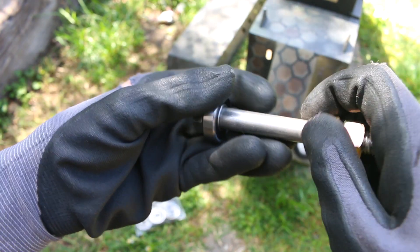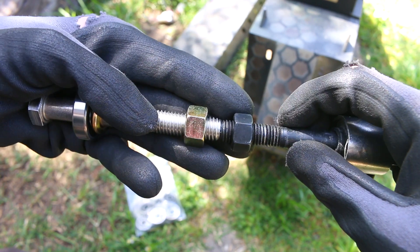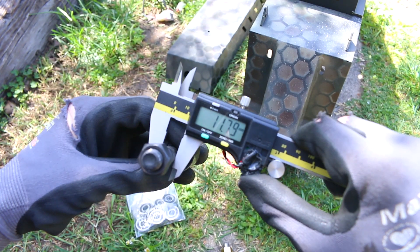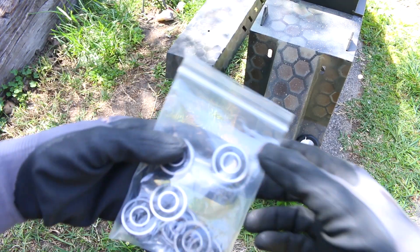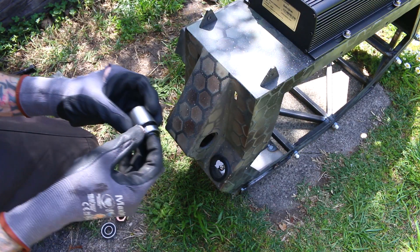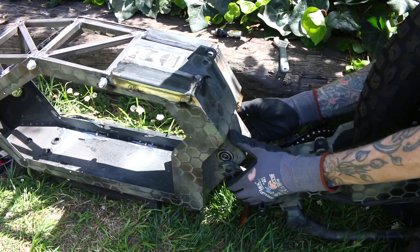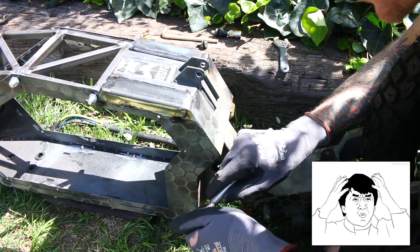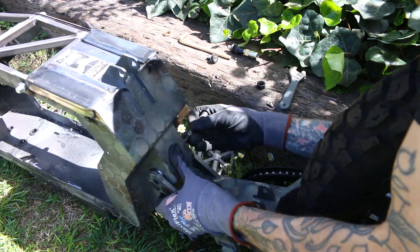I'm at the stage where I pretty much have to fully assemble the frame again, and here was that fix I was talking about in the first episode, where I had a bunch of wobble in the swing arm. You can see on the right is the old bolt and on the left is the new one. Not only will this bolt take up a ton of extra free play, but I'm also adding bearings instead of those rubber bushings that were causing a ton of wobble. The easiest and cheapest fix was just buying these very nice bearings that were only like 50 cents each. To take up some of the extra slack in between the bearings, I'm going to reuse that rubber bushing as a spacer. I had to reuse the old bolt because the new one wouldn't fit through the bearing, but even with the new bearings, it does fit a lot better.